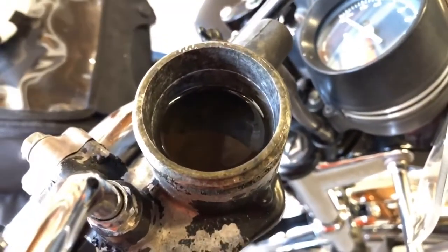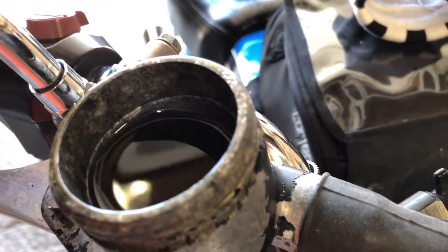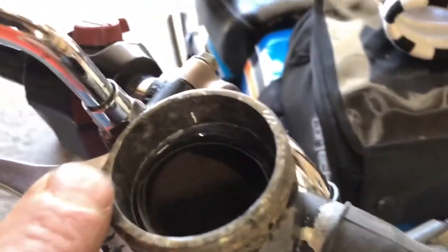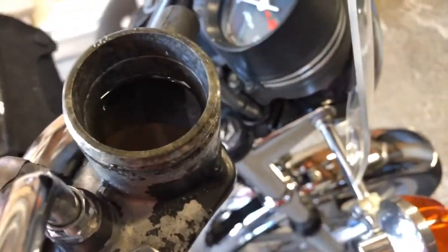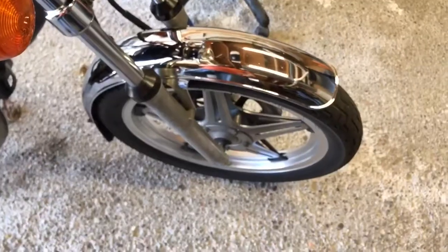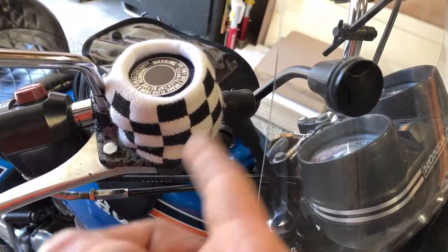I'm taking a look at this old crusty brake fluid reservoir. You can see that score line — that's the fill line. You want to check it on this side over here, because if you do it on the other side you're going to overfill it on this side. So I do it to the low side. Good to go. I'm going to button that up before I drop something in there. The most important thing about checking the brake fluid is making sure you've got your wristband back on. We can check that off the list.